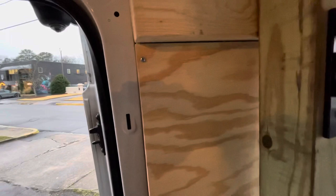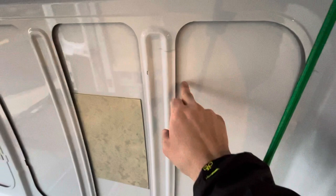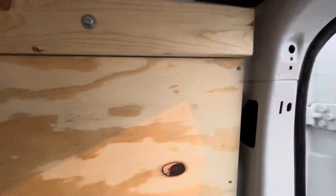Mounted across, there are some spots where you can just use a basic sheet metal screw into the frame. You're not going to get close to the exterior skin, but for stuff getting mounted around this area, be careful you don't mount anything too close — it's super close to the exterior skin and you'll punch right through.